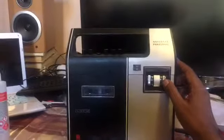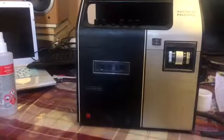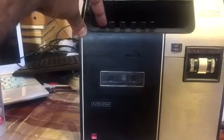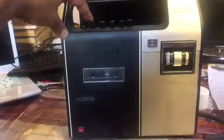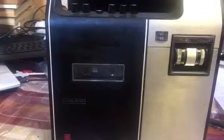I think this is the play button. Fast forward works, fast reverse works, play works. Basically needed one belt to get the play working, and a good old spray with WD-40 on the contacts and everything else.